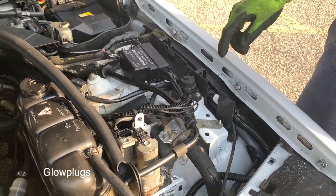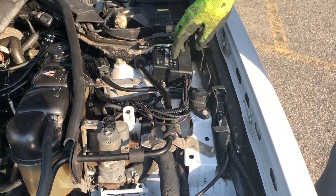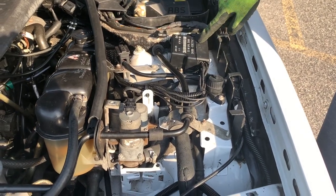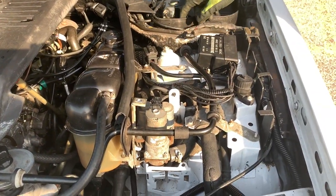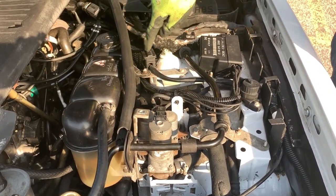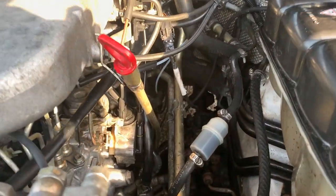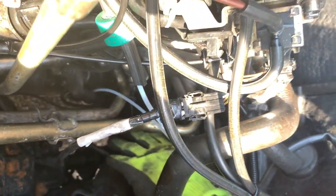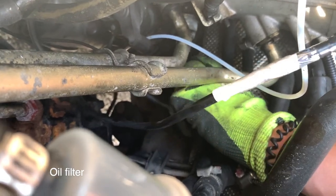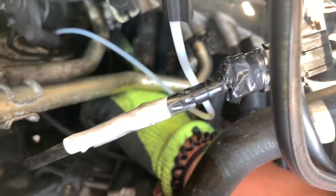While we're here, I'll also show you the injectors. This box is what controls your glow plugs — it's what controls your pre-glow when you get that light in your dashboard. There are six wires that run along here around the engine and they connect to the glow plugs individually. Also, this plug here is the cruise control plug that runs to your module, which is behind the injection pump. The last thing is the plug that runs your oil pressure gauge in your dashboard — basically underneath the fuel filter. If it's not running properly, maybe the plug is on backwards, because these ones you can actually put on backwards.